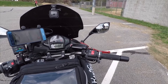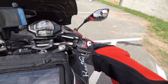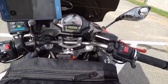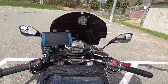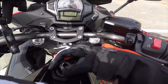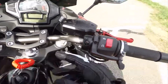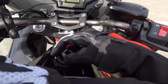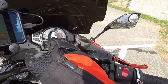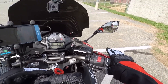To turn off your bike, you just go in reverse. At the motorcycle safety school, they're going to ask you to hit the kill switch first — that will shut the engine off — and then turn off the bike and take the key out. My alarm might go off, but don't worry. Back on: kill switch on, key to on position, everything is cycling through, hand on brake, and kick the bike on.